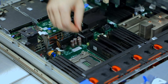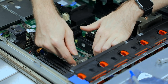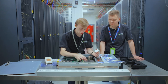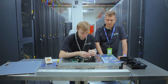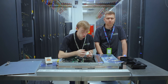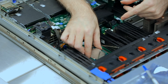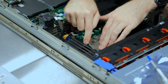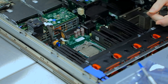When you're doing these, these particular sockets have two levers. Inside the socket you'll see it has 90-degree angles on it, apart from one where a bit is chopped off. On the CPU there's a little triangle, and you always want to match up the triangle with the cut corner of the socket. You carefully lower the CPU in without pressing it down. These are called ZIF sockets - Zero Insertion Force - which means you don't press the CPU into the socket, because you don't need to.